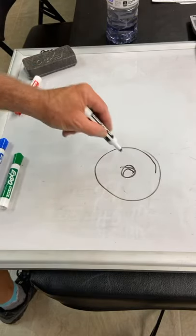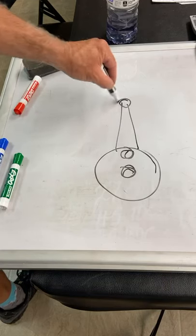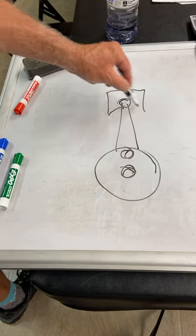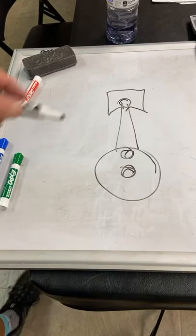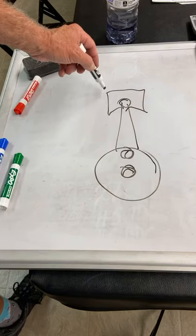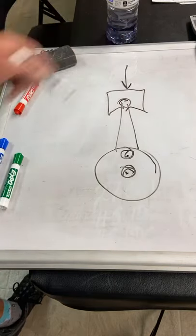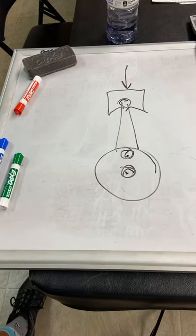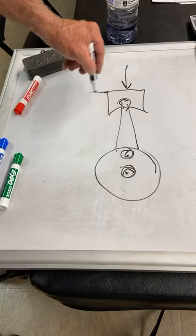Mains, rod, pin, connecting rod, wrist pin, and then piston, okay? Very elementary. But if you have peak cylinder pressure when these are in a straight line, peak cylinder pressure, you will see some things you had never seen before. You'll see gasoline light off too soon. You'll see explosions. You'll see head gaskets blow out.